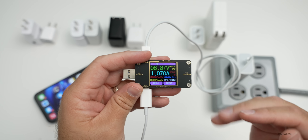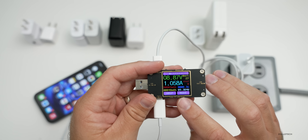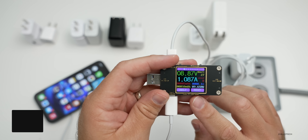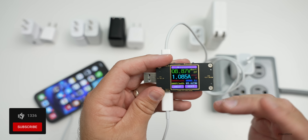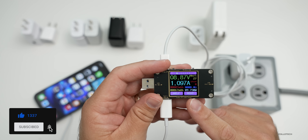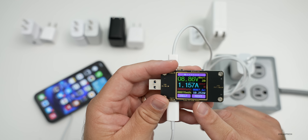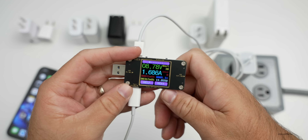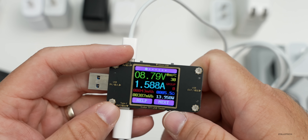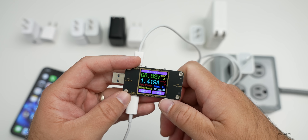It will take a little bit of time to get up to 15 watts, and the actual temperature makes a difference as well — if the phone is too hot it will not hit 15 watts. I've found that if the phone is really warm it keeps it down below 10 watts. Usually it takes 30 to 60 seconds to ramp up to 15 watts. You'll see we're at about 14.5 to 15 watts — it's at its full speed.